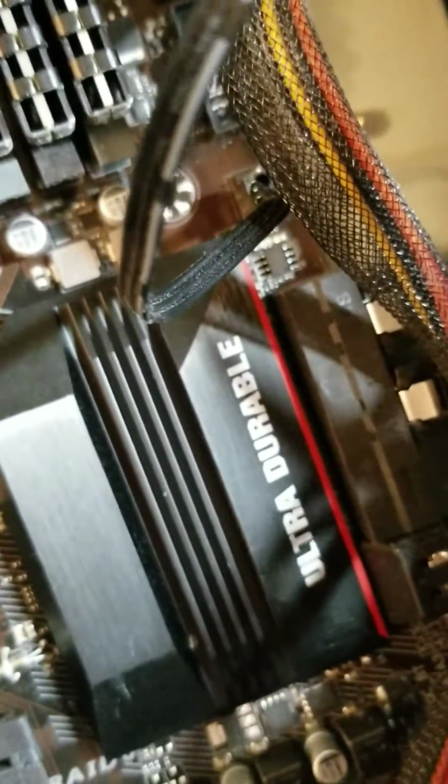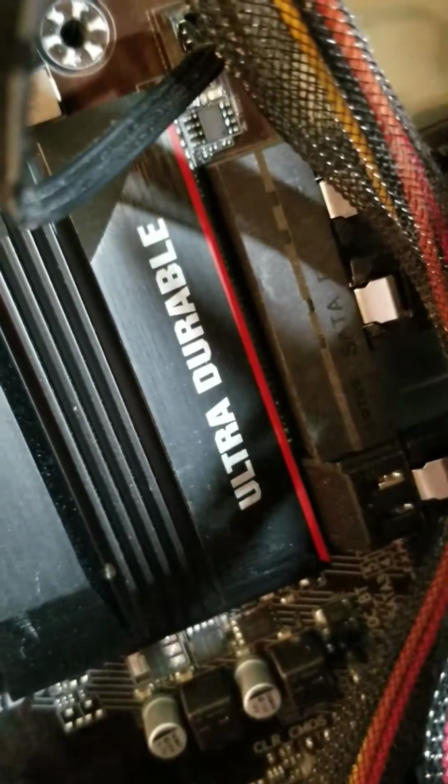So what I meant by media cables is, so this is my hard drive here. This is another SATA cable. You just want to press down on that top little prong there, this little piece. Just press down on that. That's going to release it. You're going to plug that into the hard drive there. Get it in here. Alright, there you go. Okay.